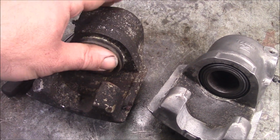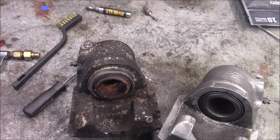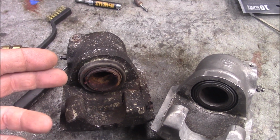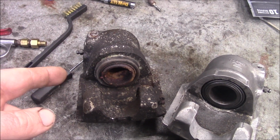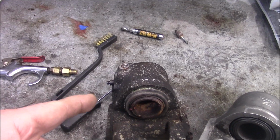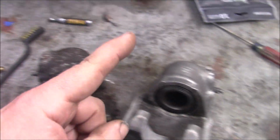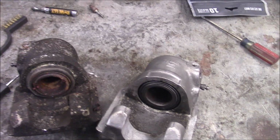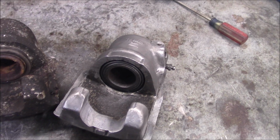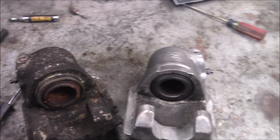I even tried putting a C-clamp on this and you can't even press it back in, which is how this one was too. You can't get the piston out with any method, the compressed air or anything. It's pretty well frozen. What I did was I actually threw a complex series of the wrong brass fittings threading into the brake line port. I pumped a grease gun into this one and pressed the piston out. And then I sanded the bores and cleaned all the rust off, and it was all good. The bodies are aluminum, and then this is steel, the actual piston.